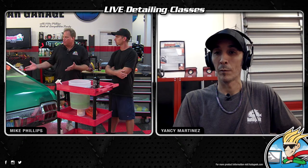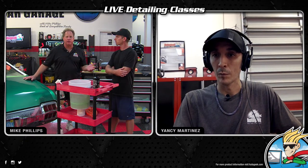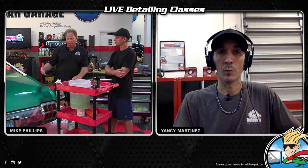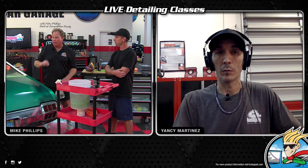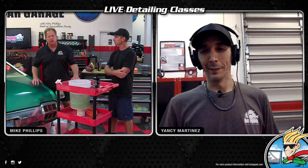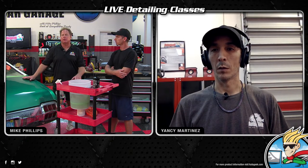Even with just a nice street rod or muscle car like this, you want it to look good, but it doesn't need to look perfect, okay? Just get it good. Leaving some paint on there is going to help the paint endure over time. Getting it so perfect that you left it whisper thin means it's going to fail. Even though you didn't burn through or make a mistake, it now looks exposed, and the paint job fails anyway because you didn't leave anything there. You want to leave something there to hold up over time.